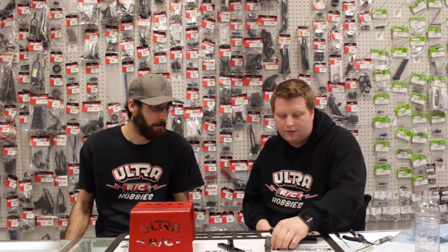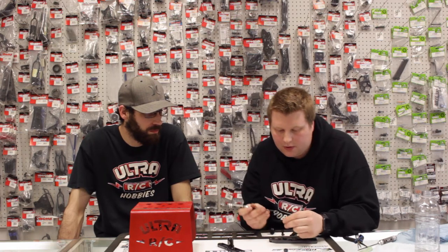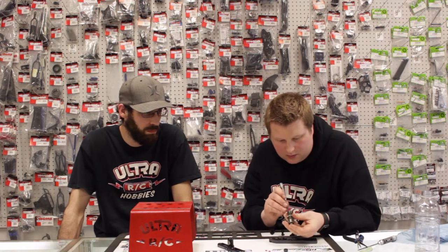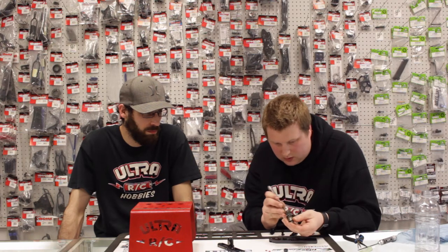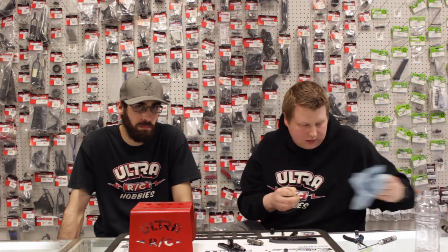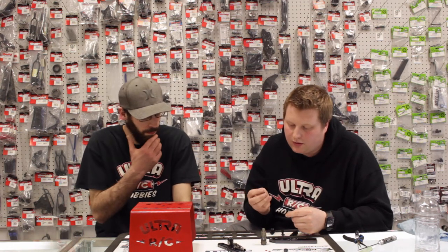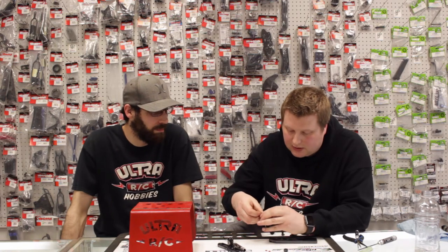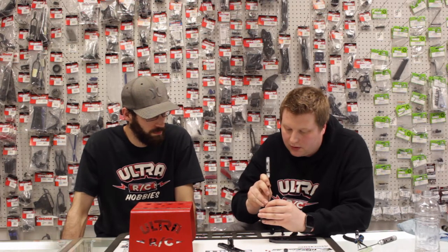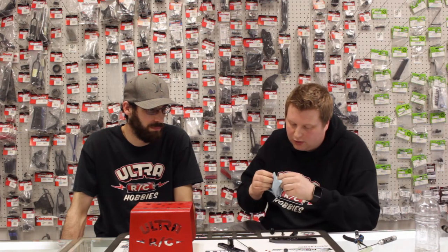With the bottom cartridge holder and shaft guide out, pop the shaft guide out — there will be a little black insert in there that the shock shaft rides in. Visually inspect it to make sure it isn't ovaled out; otherwise the shock shaft will wobble as it travels up and down through the shock body and it's going to leak. Use a 2mm driver to pop the O-rings out. There's also a spacer in the Techno shock between the two O-rings, and another shaft guide in the body. Techno also offers a Delrin set, which has less stiction and usually lasts a bit longer.